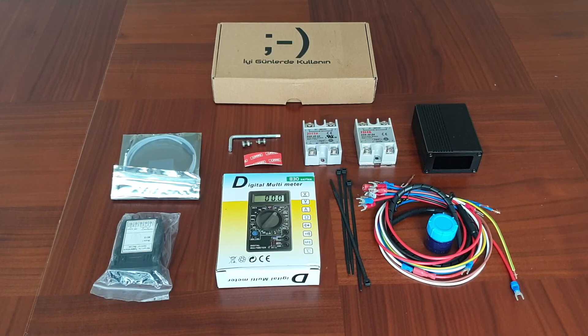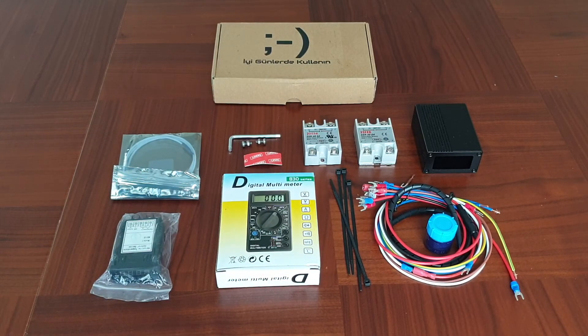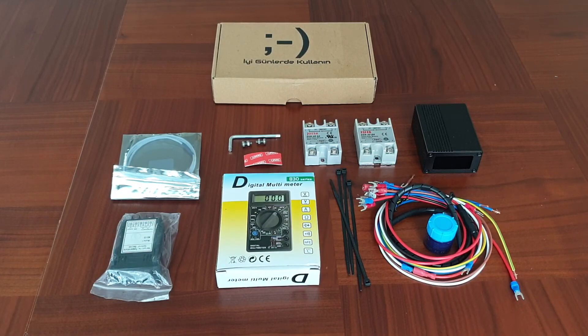The difference of my kit: my design includes keeping the steam thermostat inside for extra security in case of a malfunctioning controller, relays, or anything else. I don't prefer the thermal fuse to be burned in such a case — it saves the machine once, but you no longer have this security a second time and you also lose your warranty. The whole design has been made to keep the machine in its original state as much as possible, and the kit is very easy to remove without leaving any marks behind.